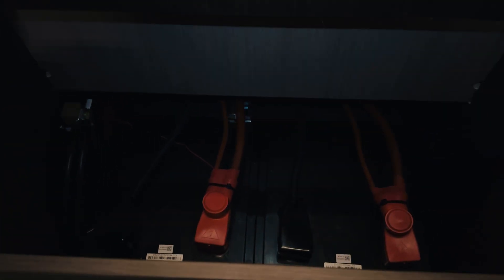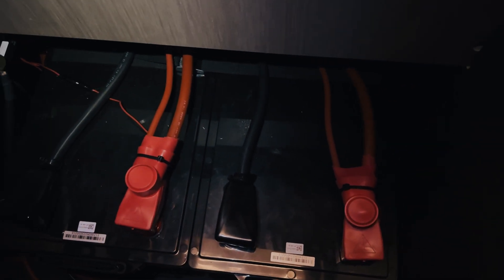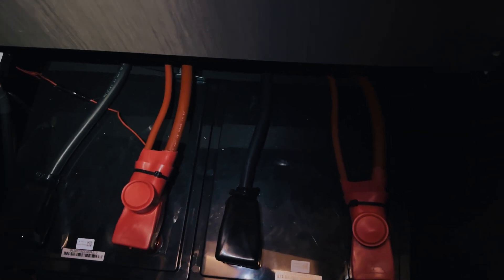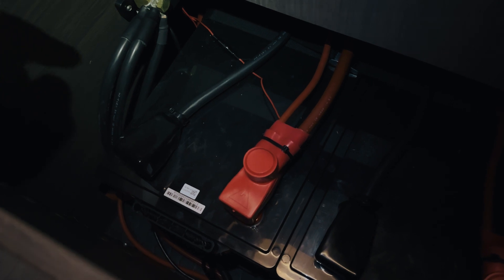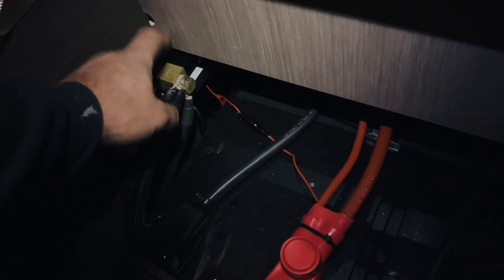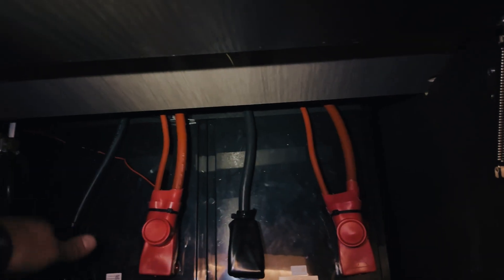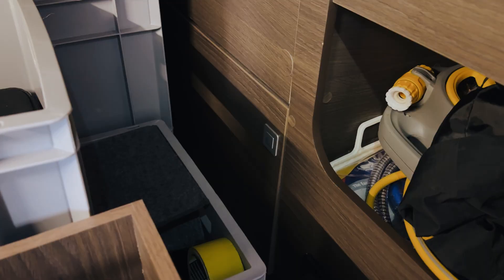Here is where we've got the batteries. This is a big drawer that goes into the garage — we took the drawer out, took the runners out, and we've been able to get both 460 batteries in here, mounted on the Fogstar battery trays. We've got the shunt over here. When we ran the 230V wires and the wires connecting the bus bars to the batteries, we ran a trickle charge wired into the shunt and onto the MultiPlus so we can read the engine battery voltage on the shunt and trickle charge from the MultiPlus. We also ran a VE.Direct cable to connect the shunt to the Cerbo. Pretty pleased with how that turned out — fits perfectly and it's a good use of central space.